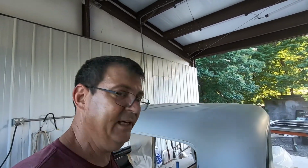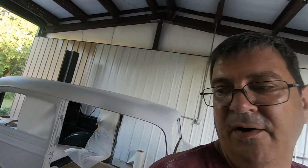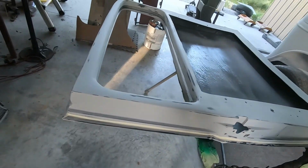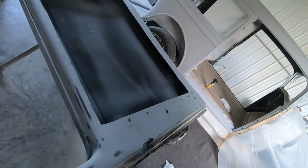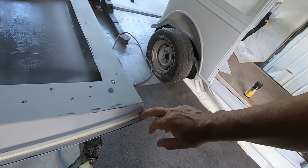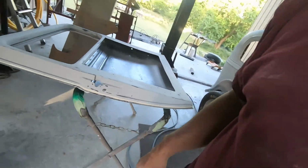I did leave you guys out on a fun day of just digging, scratching, sanding, guide coating, all those things. You can see we got it all looking good. We're down, everything's seam sealed. I'm gonna run back over it with a scuff pad here. It's like fairly fresh, but it's fairly set up too, so we want everything to stick good.